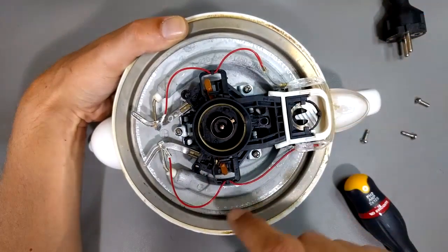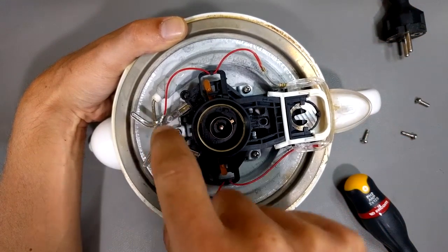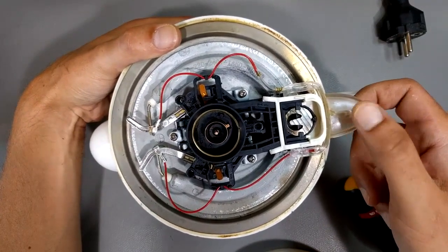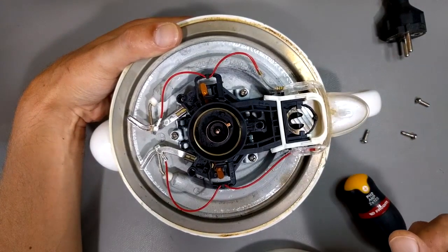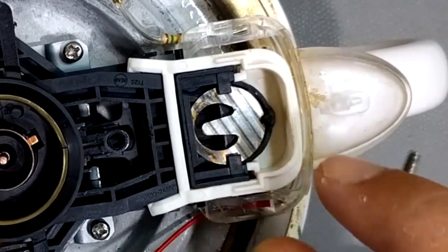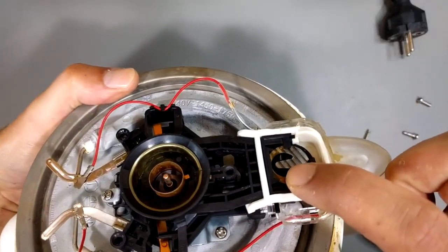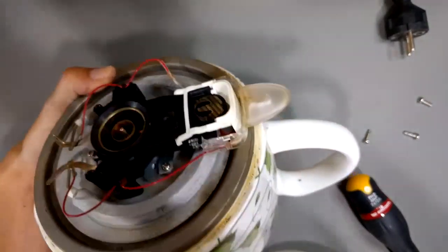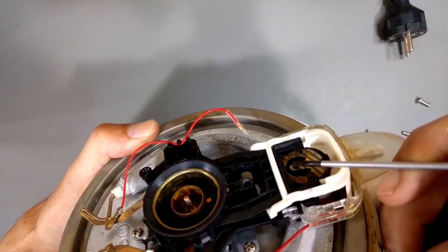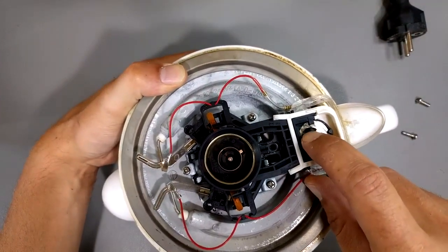You have your electric heating element around here. When you push the switch down it powers the electric heating element. Power from the two inputs of the heating element also goes through a little resistor, and there's probably a little neon lamp in here so that you know when the pot's heating. The rest of this is just this crazy mechanism, and the key component is this little guy right here — there's a little tab on the underside of this little bit of metal.